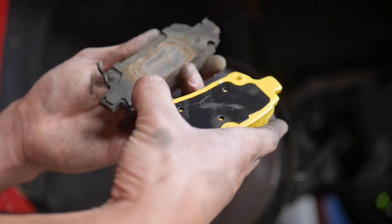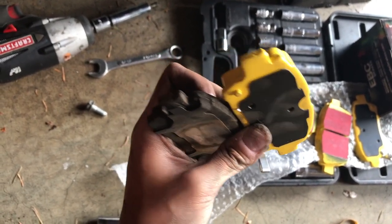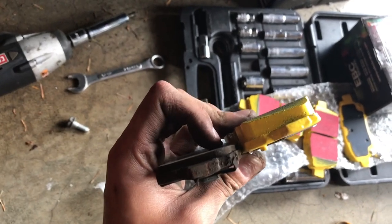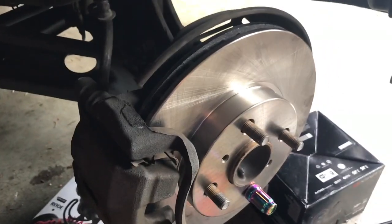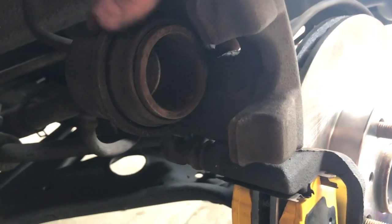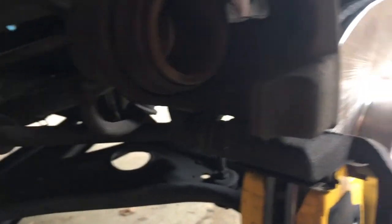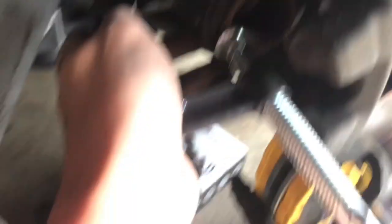This is the corresponding pad — little push tab on the same side. My camera ran out of memory, but look at the meat difference between old and new. That is crazy. I'm going to put it in — it's basically the same thing for the rear, a little bit more in depth. So I got the new pads in; that's a nice setup right there. I have to push this piston back because the old pads were so worn down. You get a vice grip, grip it on both sides, slowly push it back — it pushes the fluid out so you can get the caliper over.